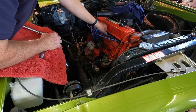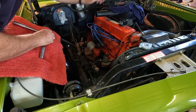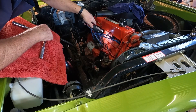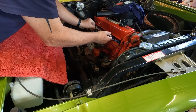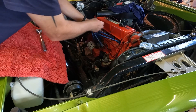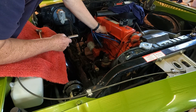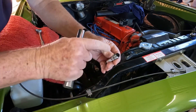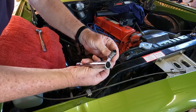We'll do this one. I like to just crack the rubber boot to make sure it's not stuck too tight, then pull it off. Just quickly check for grit - if there's any grit I blow it out with compressed air, but there's not. I find that most of the plugs are the same condition when I take them out of this engine. This one's very similar - it's got a slight brown tinge on the top, probably a little lighter down the bottom, but again the sooty-ness on the top. So it's pretty much the same.